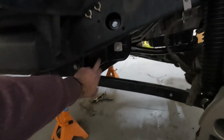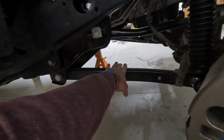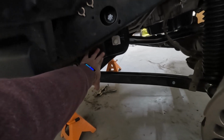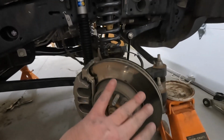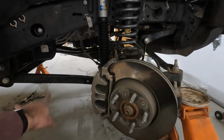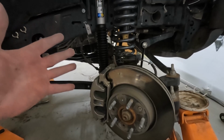So I'm going to tighten up the bracket bolts so that that's on solid on both sides. The control arms are not supposed to be tightened until it's sitting on the ground. So I'll get this thing attached solidly. And yes, I did have to go to Home Depot and get a new bolt. Of course, we cut the other one. Get this attached, get the wheels back on again, hopefully for real this time. Drop it down, connect those. And then, technically, the AEV lift is done.